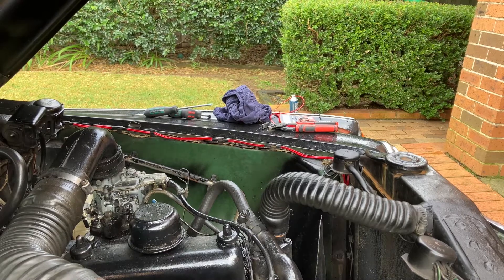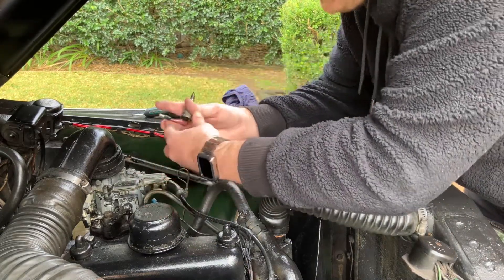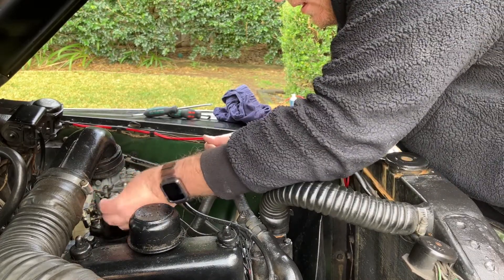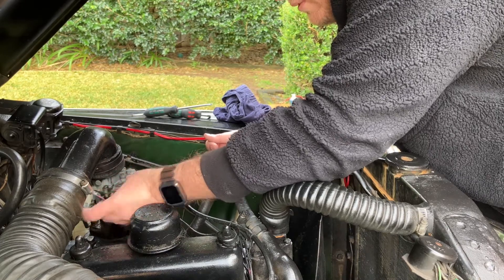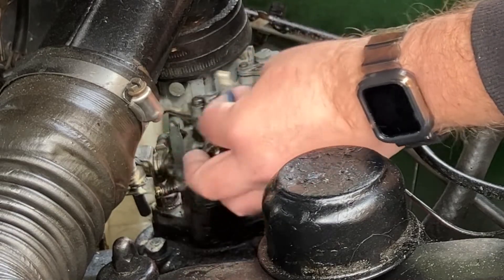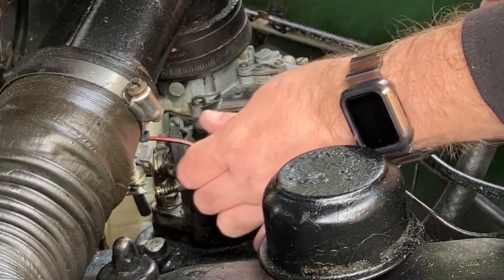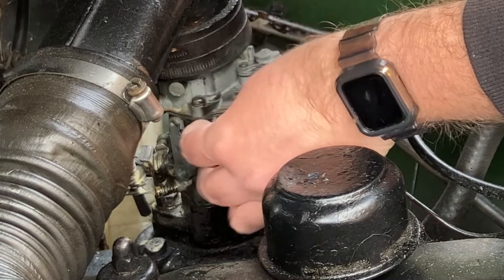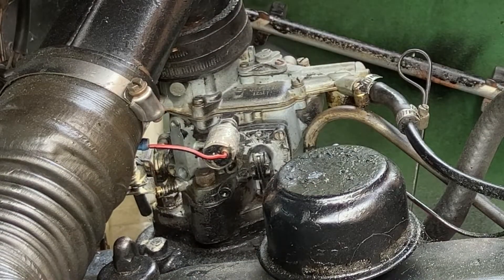Now I've got this working and when the key turns it does actually actuate. So I'm going to put it back in, and hopefully what that will do is shut off the fuel from flowing through the carburetor when the key is off, meaning the excess fuel isn't still flowing into the engine. If it flows in unburnt like that, it flows in and explodes on the heat of the exhaust manifold — and that's what was causing the issue.